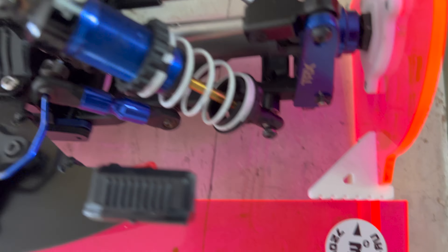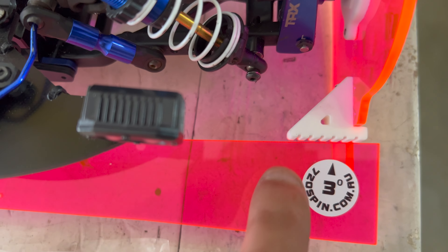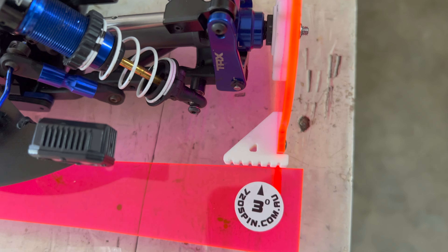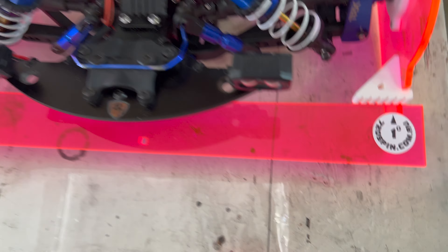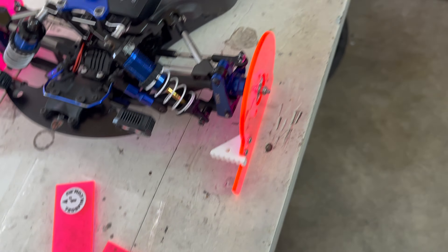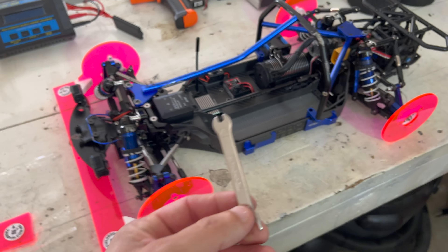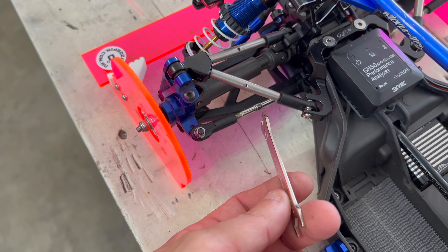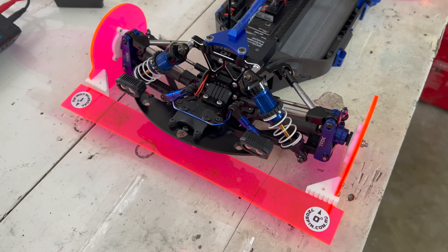Now you can start to see a little gap right there, not so much right there, but right there — that little adjustment would give you three degrees. Another example, let's go by one degree. I have a little bit on the corners right there, you can see them. Now zero degrees — yeah, I got more going on the corners. So the best thing to do is pick your desired degree, take your little turnbuckle wrench, and start adjusting one turn at a time, actually half a turn at a time until you find the desired one you like, or which one the car actually likes.